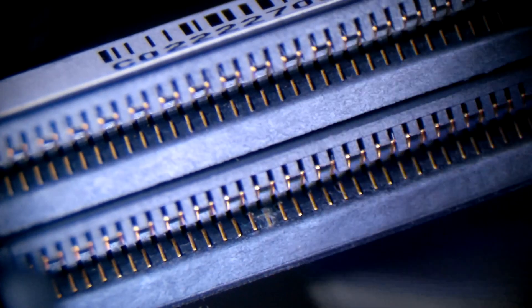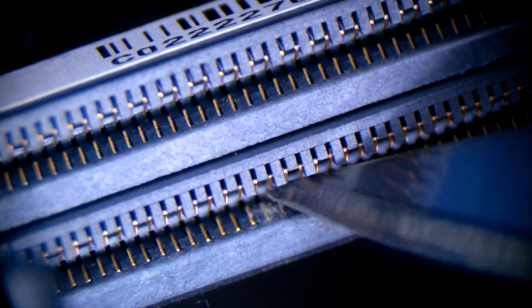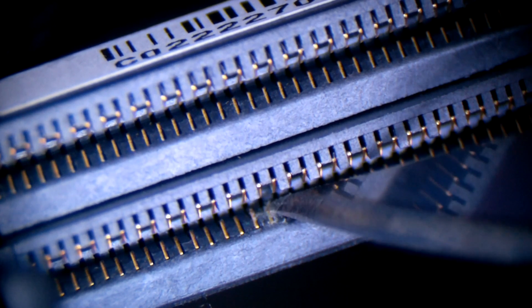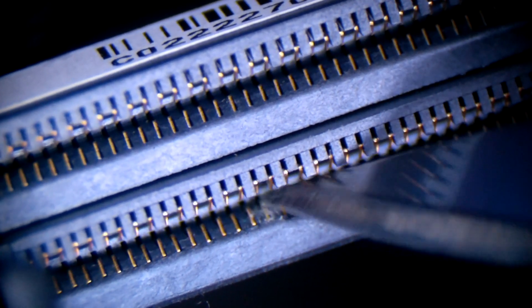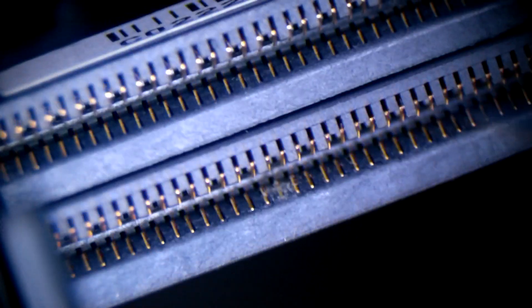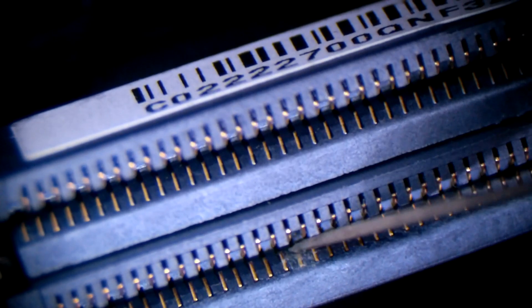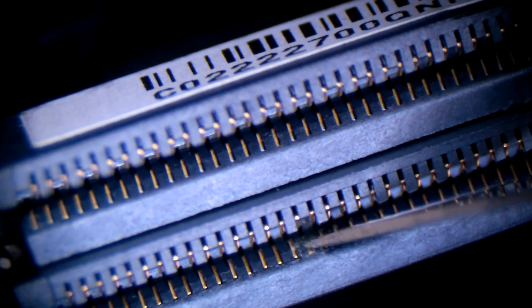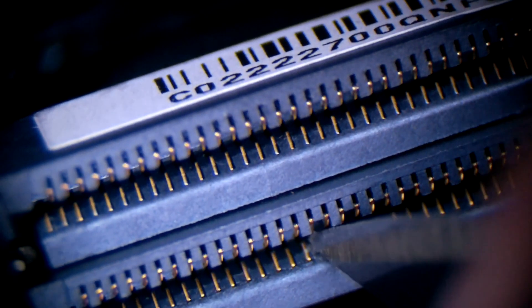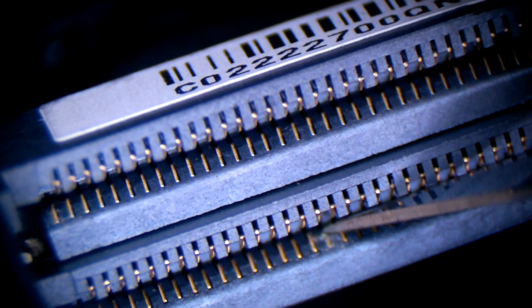As you can see, this is just corroded there. So we're gonna clean it up and we should be good to go. Also, we need to adjust it a little bit — push it in or out, whichever way you look at it. So let me clean it up nicely first, and then I will adjust it. I'm basically scraping so we have bare metal contact there — scraping all the corrosion off the top of the pin.